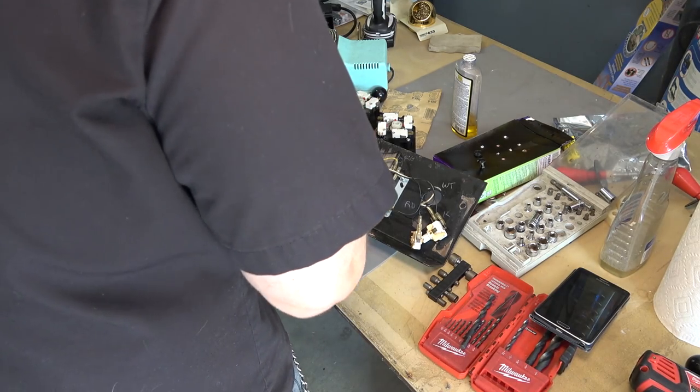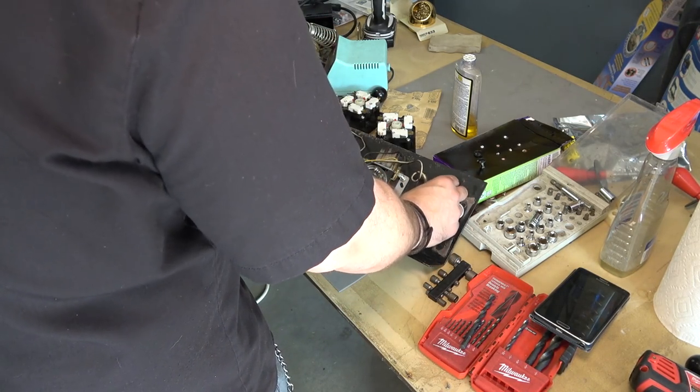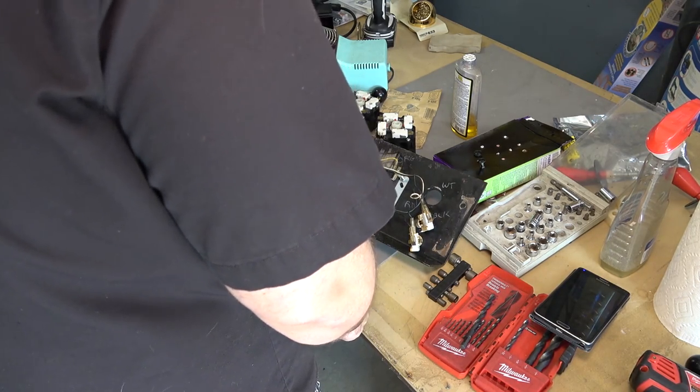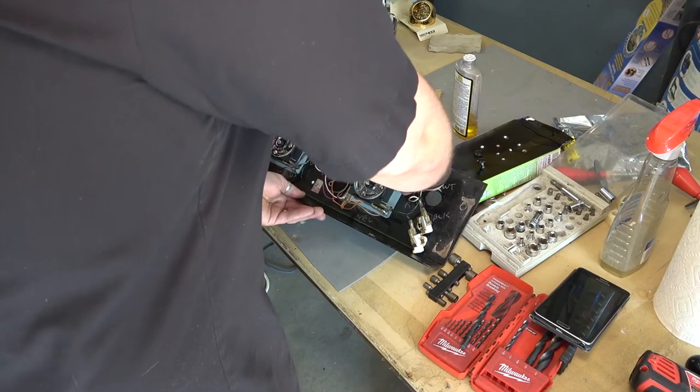It has a pull-up resistor. And so when you hit a switch, you're grounding it, which makes it a 0. That's why you can see the ground is daisy chained, shared overall across every single one of these switches.